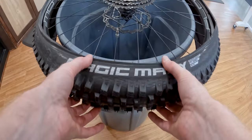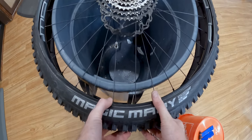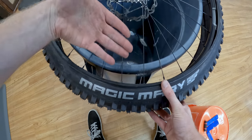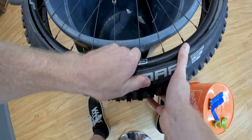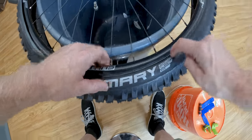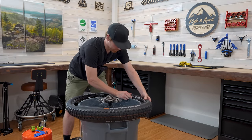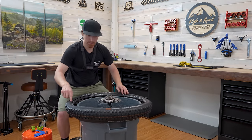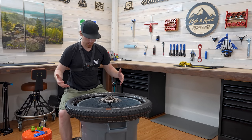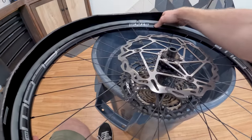Take your hands, get the bead just past the Cushcore, pull back slightly, and with the other hand support the Cushcore. Once you get it started, get the bead tucking underneath the Cushcore. The goal is to do this without pushing the Cushcore off the rim. You'll usually be able to get it around 50-60% of the rim before needing to do anything else. Be careful — if this portion of the Cushcore comes off over the rim, the whole thing will undo and you'll have to restart.